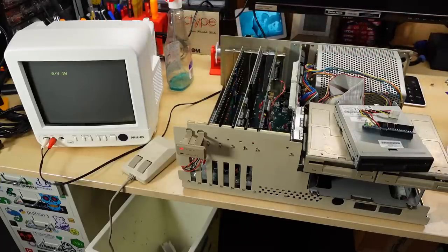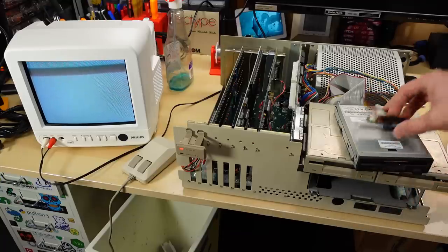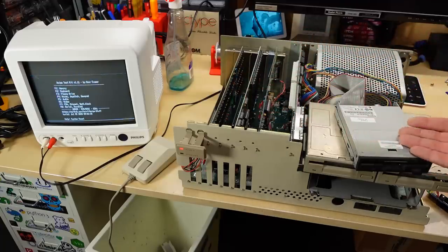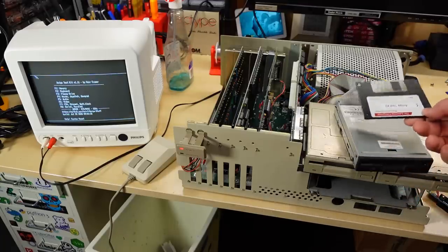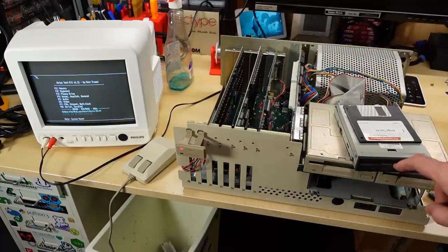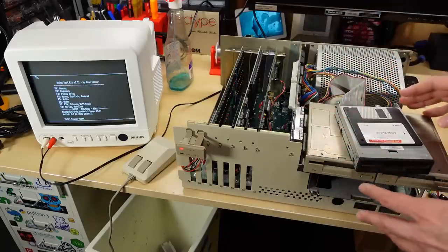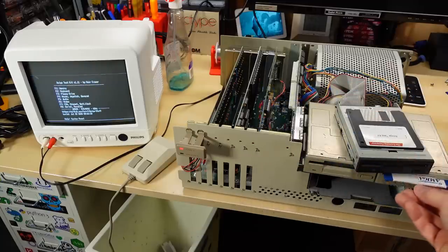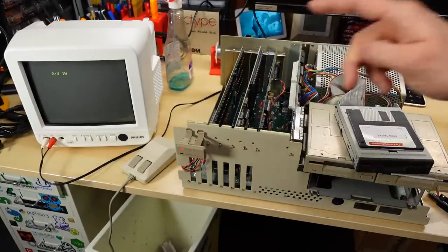Let's unplug both drives and plug in this cable into the PC floppy drive to see what happens without the adapter connected. TV is on, let's turn this on and stick in the Amiga test kit disk. It just worked — that was unexpected. I didn't think it would actually work, but it did. But I think one of the problems is when I take the disk out, the Amiga doesn't know I've removed it. The signaling on PC disk drives is very similar to the Amiga one but not fully compatible — it's enough to boot up though.